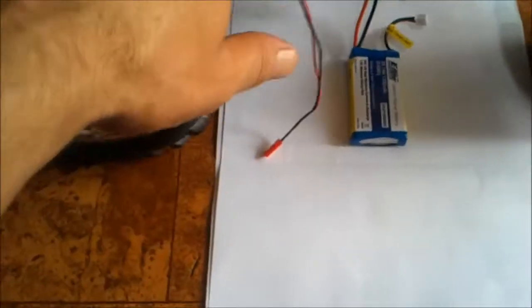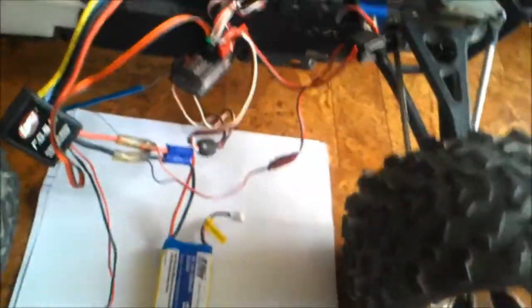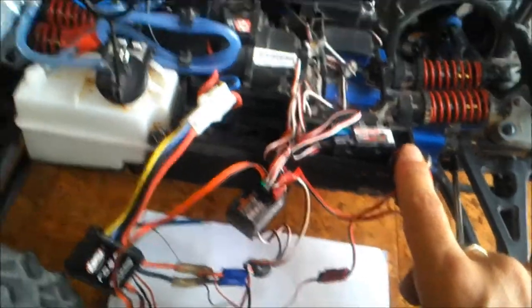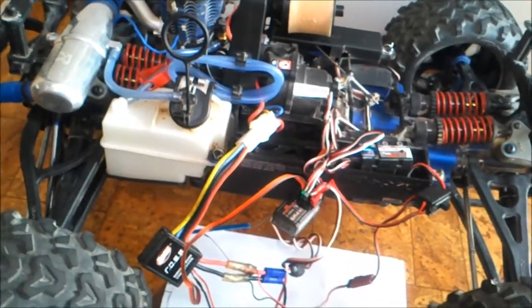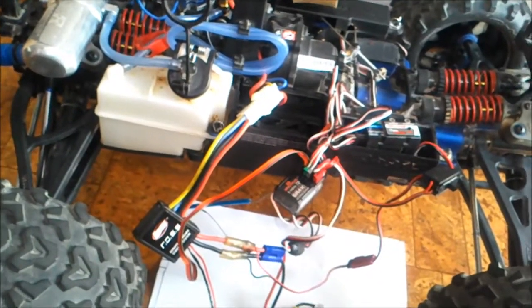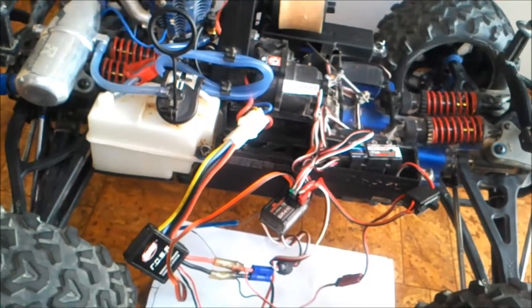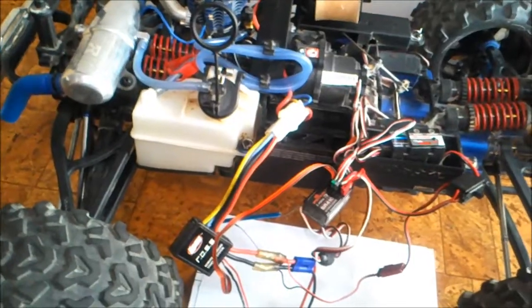That is your DX4S Spectrum transmitter with a ROS onboard starting system, and still using your Traxxas sensor and your main Traxxas switch. Now you have an onboard starting system. Thanks for watching — I will put this vehicle back together and we'll look at part 2 when the vehicle has been put together, with some fuel in, and we'll start her up.